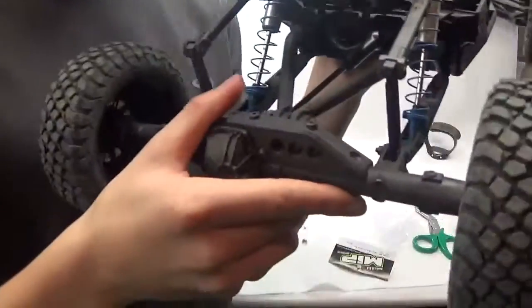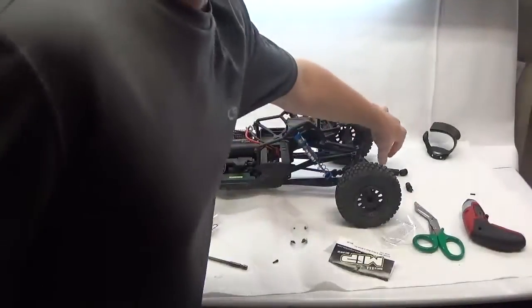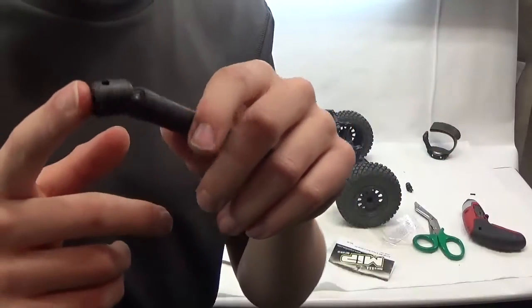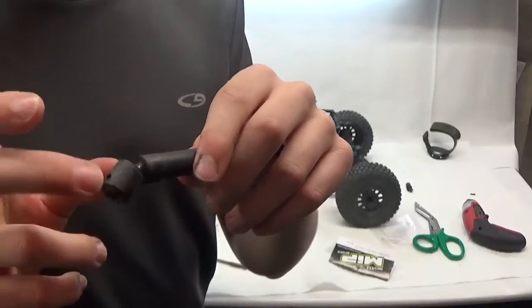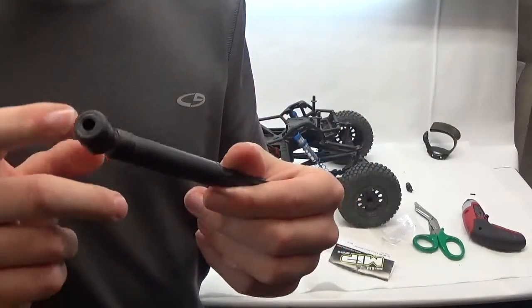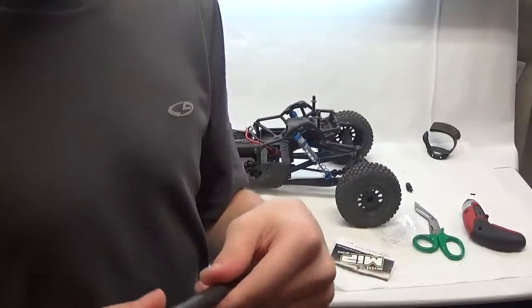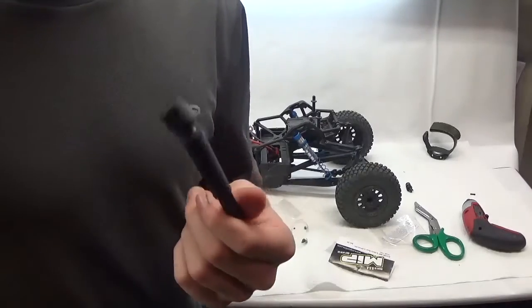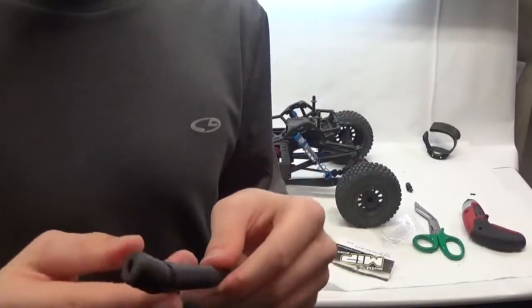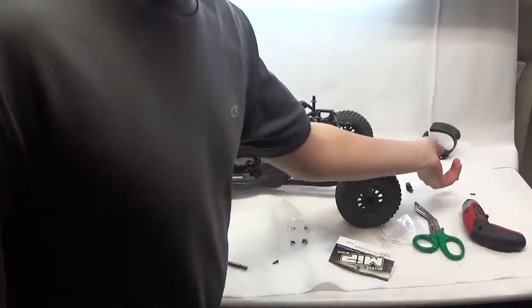But I hope you guys like this product. It's definitely something good, because I've been going through the drive shafts, and if you're wondering what the weak point is on these, it is actually the U-joint that strips out and comes off the end of the plastic. It's nothing to do with the actual shaft. It's actually the U-joint. So if RC or Axial spent a little more time to beef this end up with some metal or something, I think they'd be doing fine.